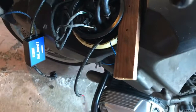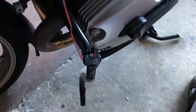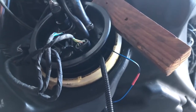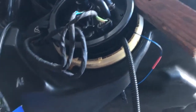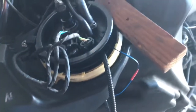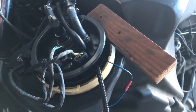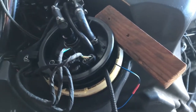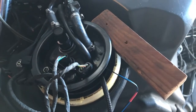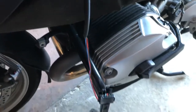So right now, I have my fuel pump pulled out, and I've got my good fuel strip hooked up to it. I ran a good calibration on that fuel strip with no problem, and I verified that it worked. And then when I swap everything back to the FC2, I still don't get readings. So today, I'm just going to put this fuel strip in some fuel and verify that it's changing levels and working like it should, and then hook the FC2 back up to it and see if anything's changed. Right now, I'll go ahead and get some gas and drop this thing down in it and take some readings.